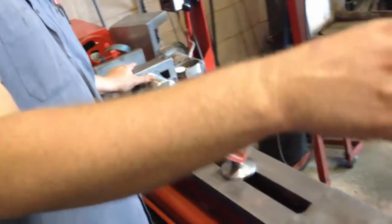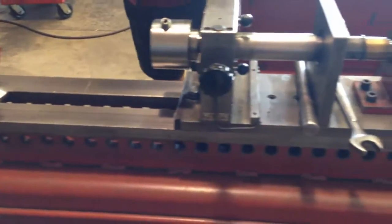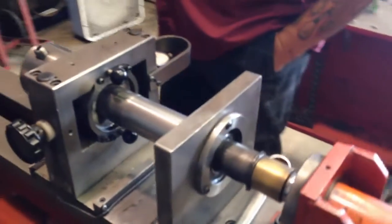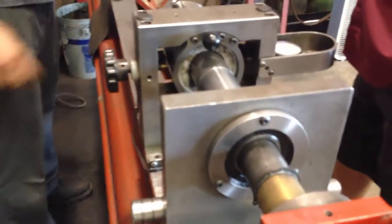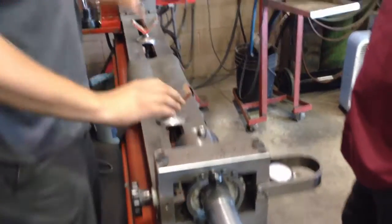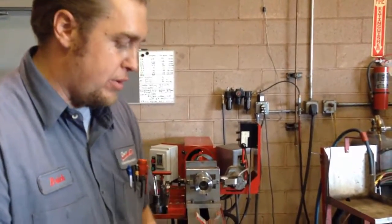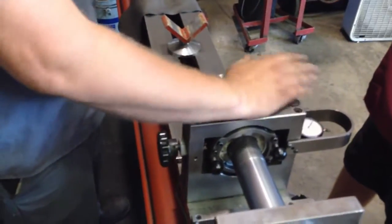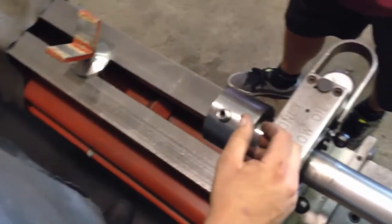On one end, it's got a 10-ton press, air over hydraulic, that will allow you to force the weld yokes into the tubing. And that's something sometimes people don't realize, Tim, is that the weld yoke is a press fit into the tubing. Mm-hmm. So not only is it welded, it's pressed in place. And then after we measure the amount of runout, we can unlock these heads and this will float. That allows us to then spin this up at speed. The dial indicator shows you how much movement you have in this floating head. That assists in how much weight to add.